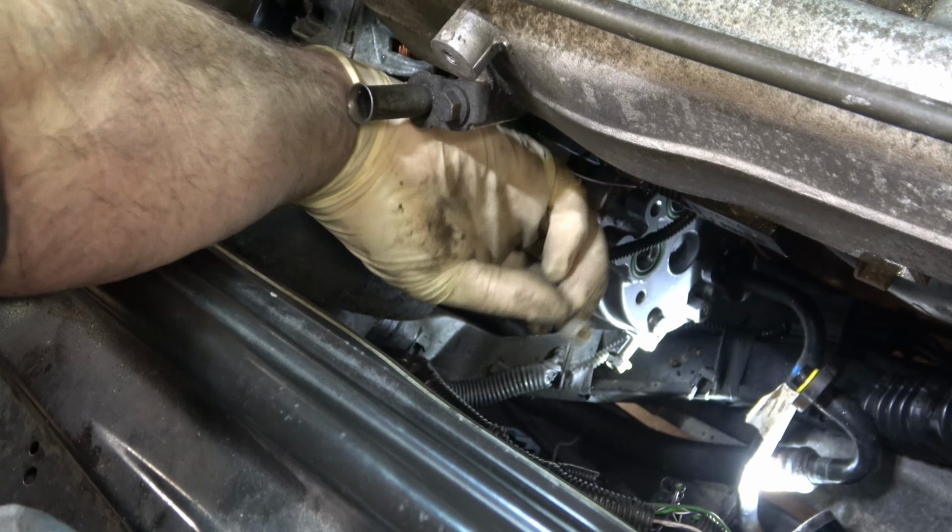We're ready to reattach our turbo hose. Once we got that done, I mean, we are making short work of this. Told you going back together is a whole lot easier. Once we put our turbo hose back in the general right area, we can reattach that last little piece of wiring so that it doesn't get caught up in anything. And then we've got our hose clamp that we took off before so we could kind of bend stuff around. We're going to go ahead and put that back on the soft rubber part.